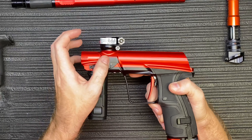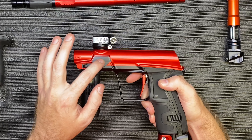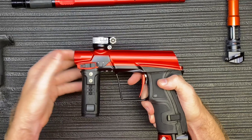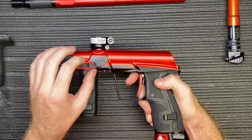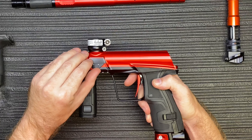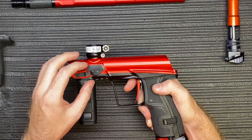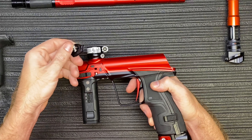This is of course where you change your battery as well, but this is a small little plastic slide. In order to get into where your eye sensors are and your detents, you just want to slide this piece forward. It's pretty straightforward — I'm not having to use a tool or anything. It slides forward and backwards. Then you want to take your nail or the bottom of your thumb and lift up on this piece. You don't need a tool; if you have to use a tool, something's not working right. Go ahead and pull that piece up and pull it off.